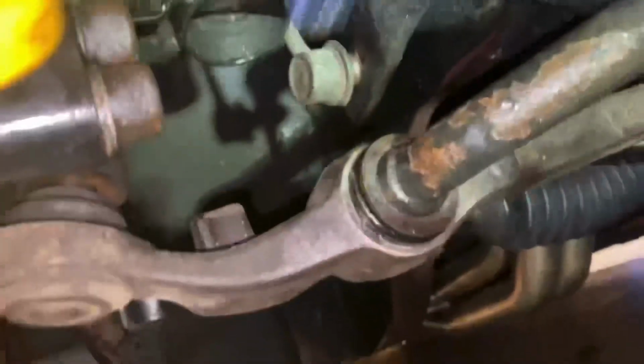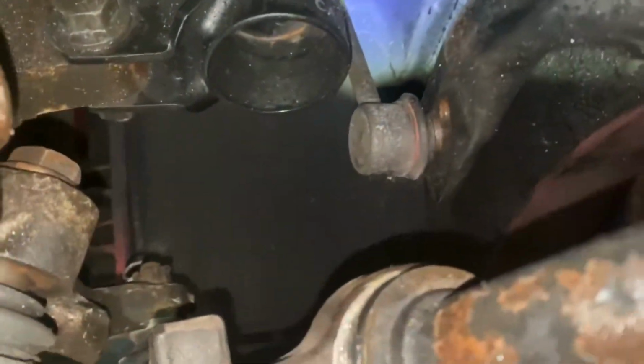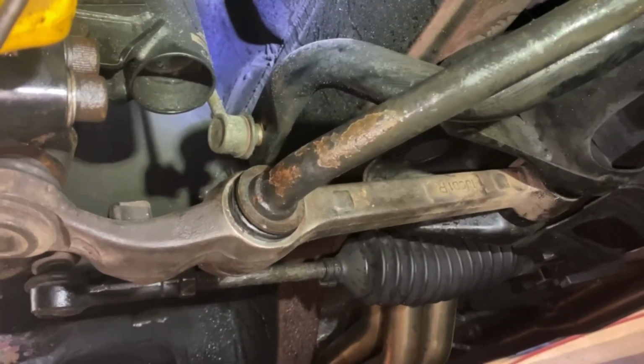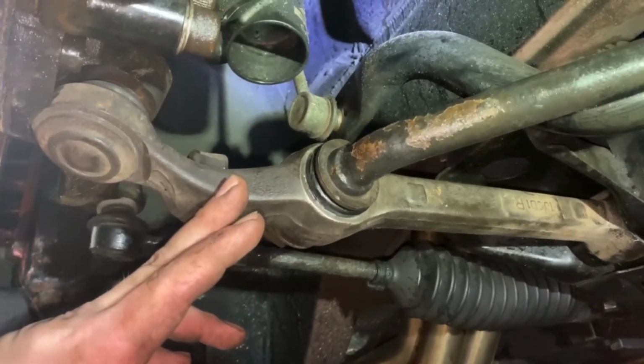All right, we are in the home stretch. So I have my lower control arm in here, but nothing is installed, or nothing is completely tight. Not this bolt and nut, not even the plate up here, your radius rod bushing up here. None of this is tight. So with suspension, and this is the most important thing when doing any sort of suspension work, you have to have preload or tension on the parts of the suspension before you tighten stuff down.